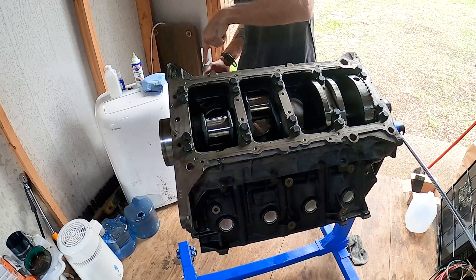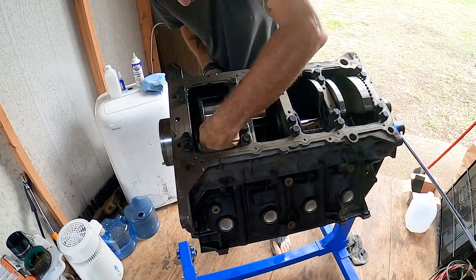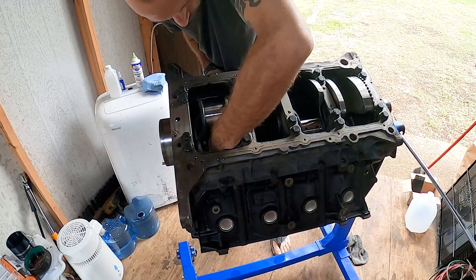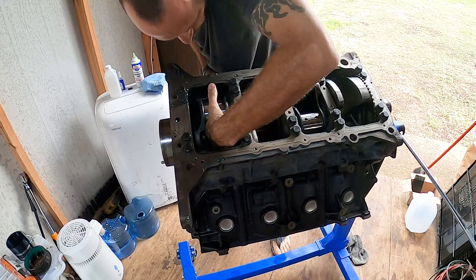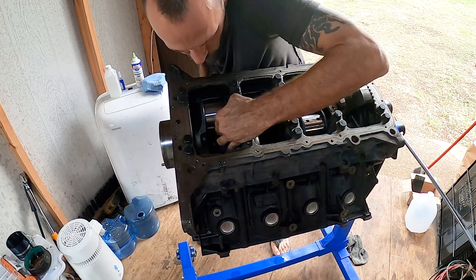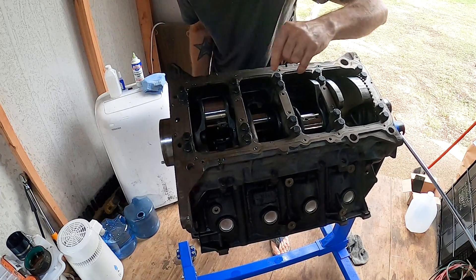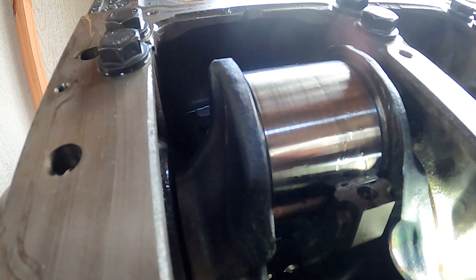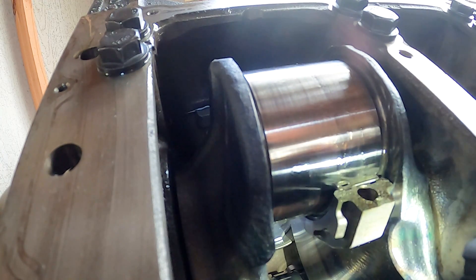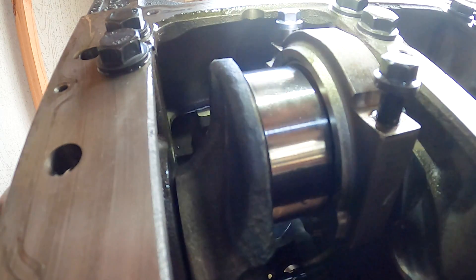Piston 7 is right on this side over here. I'm gonna put the crankshaft up a little bit, move my hand in here — you can also use a pry bar or something like that. You should be able to just slide the piston in with your hand; shouldn't need anything else. It's on there. You can see on the side of that piston the numbers 6871, which match up with that side — 6871 — so that is the correct orientation for the rod.